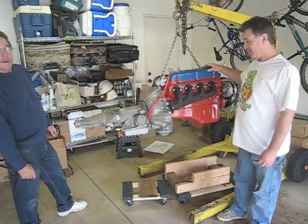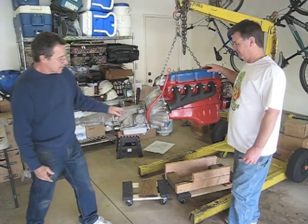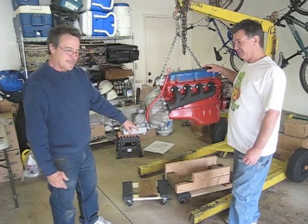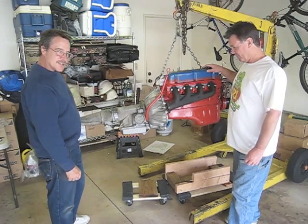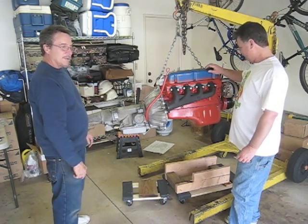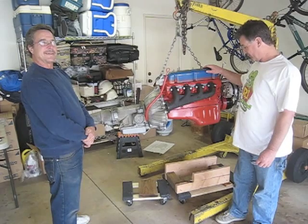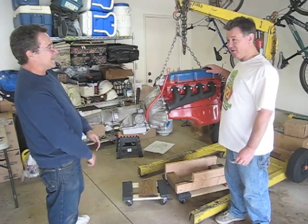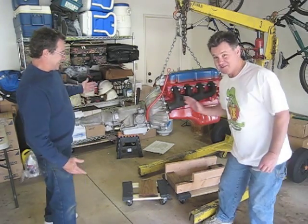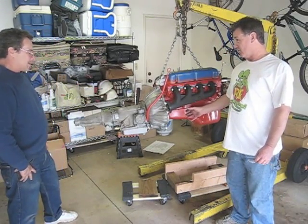The bullet I'm most happy about, we were concerned about having to rotate the engine in order to tighten the bolts that fasten the flex plate to the torque converter. We would have to turn the engine, and it's difficult to turn. We had to use the front crank snout bolt, and luckily we were able to do that and turn the motor without having to use other methods which would have been less fun. This has not gone together as easy as we thought, but we are making great progress. This, my friends, is an awesome sight. Next is to put the starter on? Home stretch.